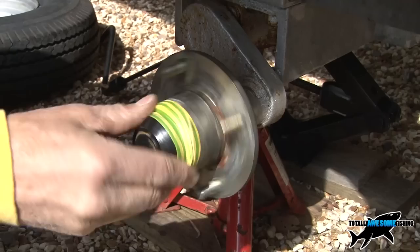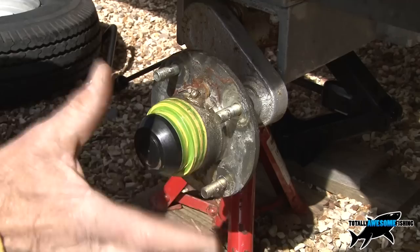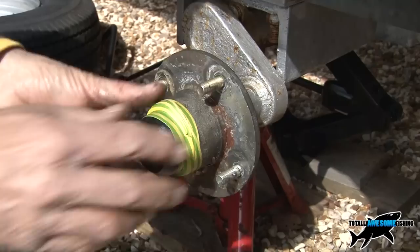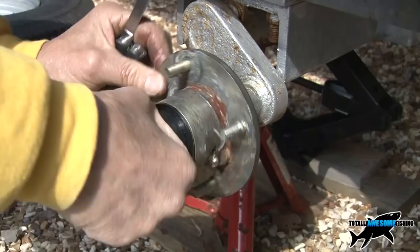Now I'm in a position to see what's going on in here. It might look a bit peculiar, but I've got some electrical stretch tape here around the little hubcap — because I put a lot of grease in there, it normally comes out of that wormhole. I've probably put too much grease in there. I've had these pop off and it splatters everywhere, and I'm concerned that if one comes off on a long run — which happened coming back from Cornwall — it might actually empty out totally. You can see the bits of corrosion around there. So I'm going to peel this off and take a look at the inside. We just cut that off — you can see it just holds it on.